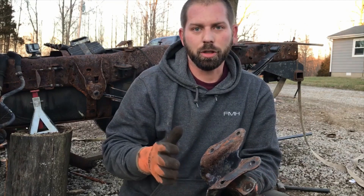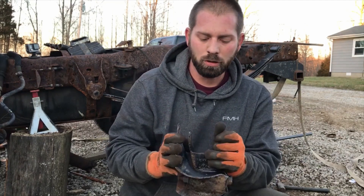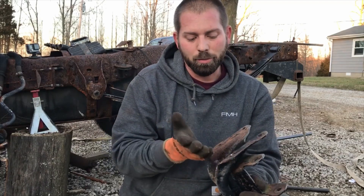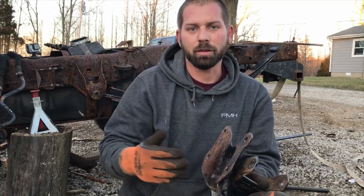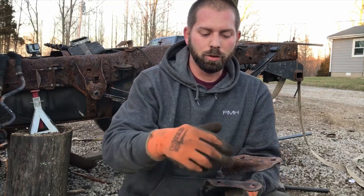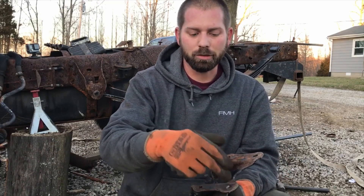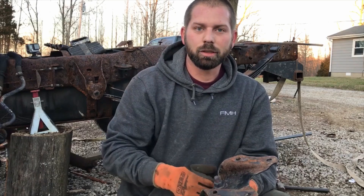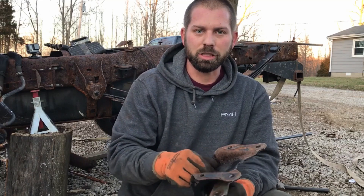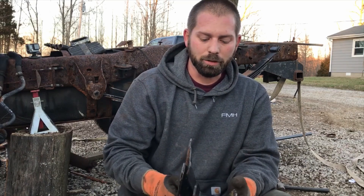If you're going to change out your hangers and your shackle — since this truck has a Reese hitch on it that hangs below the frame rail — you cannot get to this nut from the inside as it goes on the truck. So in this case we replaced them anyway. We torched off the rivets and we're going to put grade 8 bolts back in there. That allowed us to get in and change this, and you can get to the nut and put it all back together.